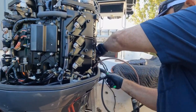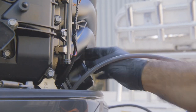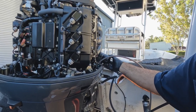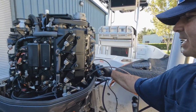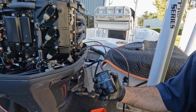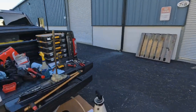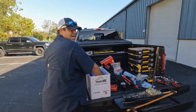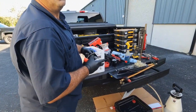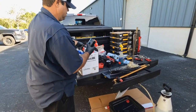This particular model takes an N26 oil filter. This little trough here — it's dry — is made to catch oil. Tip it up and hold it there until it stops dripping, to catch oil instead of it going in the pan. This is empty right now. Usually if you let the engine sit and not run for about 24 to 48 hours, that filter will drain itself.